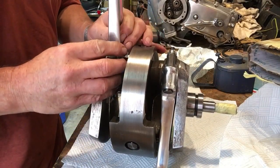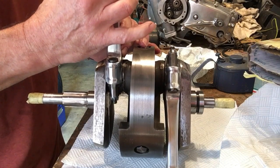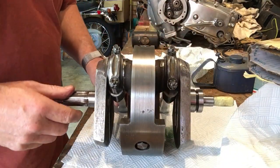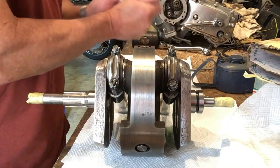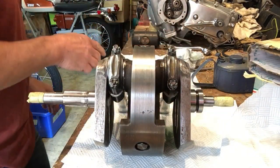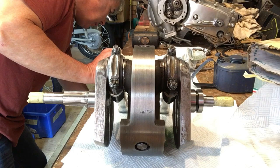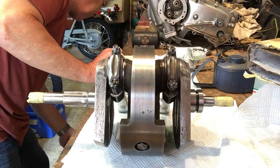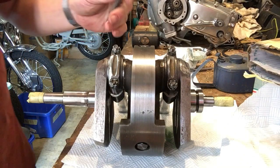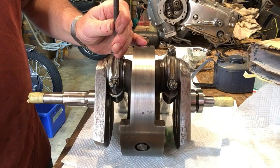Torqued up. Nice and smooth. Little side to side which you can hear there, which is normal. Nothing perceptible up and down, and that's without oil pressure. So there we go, that's that job done. Now these are the factory stiff nuts but what I tend to do is give these a punch. It's never happened to me that these have come undone on an A65, but they have on a T160.